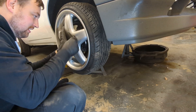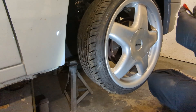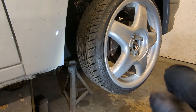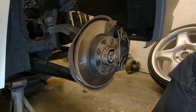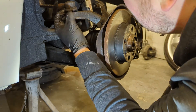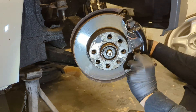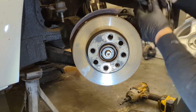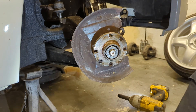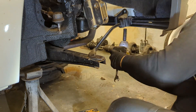Repeating the process on the other side — this cap is proving a bit more difficult, so I put a little bit of tape around a screwdriver. I unbolt the wheel, remove the circlip from the driveshaft, and unbolt the 30mm nut. The track rod end nut is removed using a 17mm socket and impact driver. I shock the ball joint out by hitting the side of the carrier with a mallet — being a tapered ball joint, this trick works really well. I can now turn the steering and remove the retaining screw from the disc and the two 10mm Allen bolts holding the caliper hanger to the carrier. The caliper slides off and is clipped to the shock. The 13mm lower ball joint pinch bolt is removed and the driveshaft is pulled out. I then remove the two 19mm clamp bolts for the shock and pull off the hub assembly. The tie rod is then unbolted from the cross member.